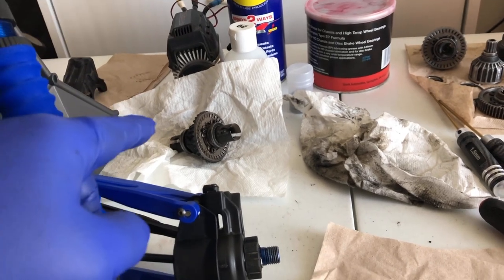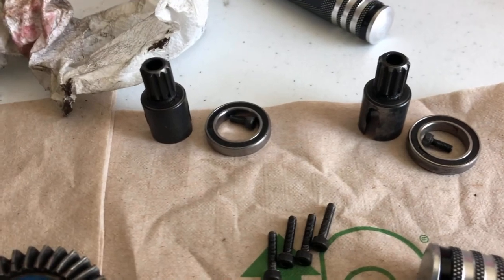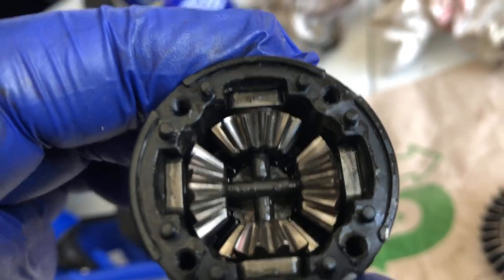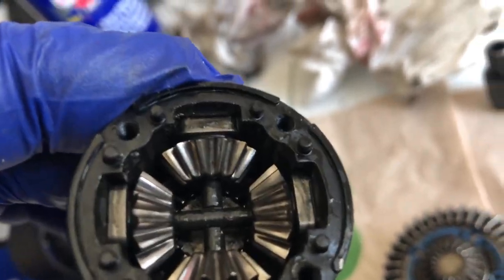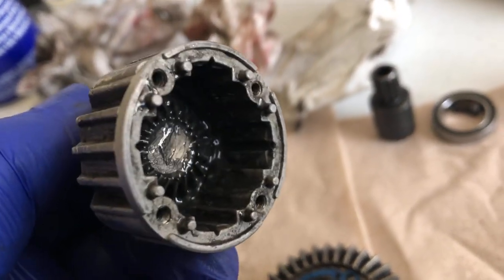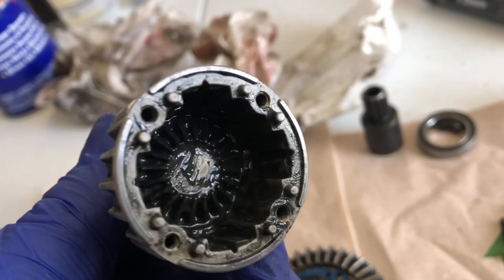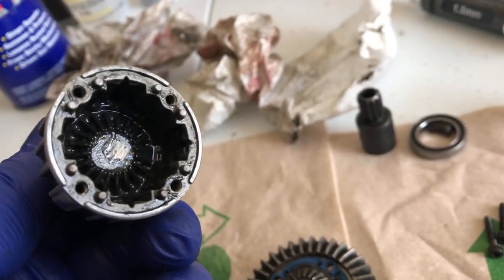I'm going to take a look at this front diff, get it cleaned out and re-greased. But this is a trip — when I opened up this rear diff, it was absolutely empty in there. Nothing. And I can't believe these gears are still good — that's unbelievable. The center diff was empty too, which is wild. This is all that was in there, and that's supposed to have 20-million-weight in it — supposed to be like silly putty. I just can't believe whoever owned this before me just bashed it until it broke and then got rid of it — that's probably why it was at a pawn shop.